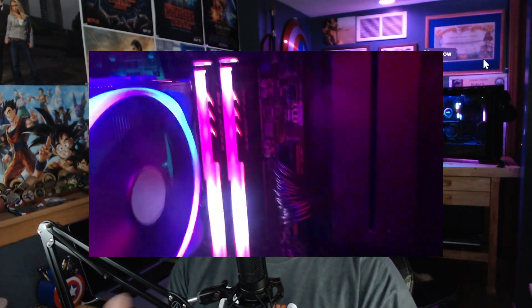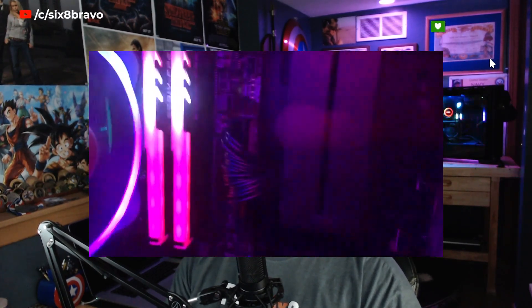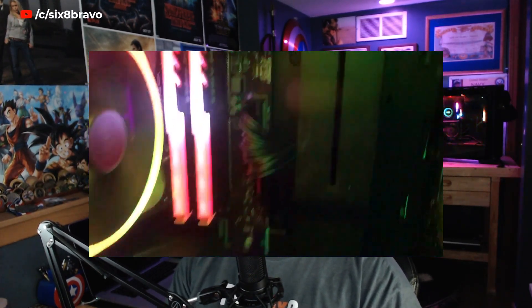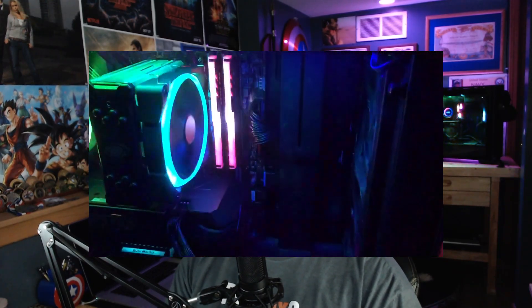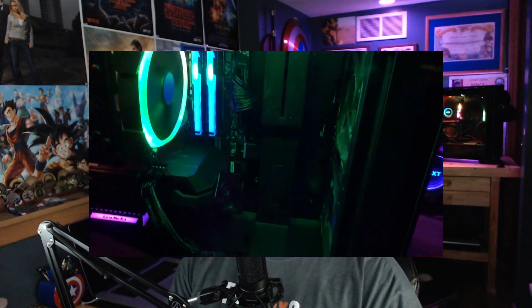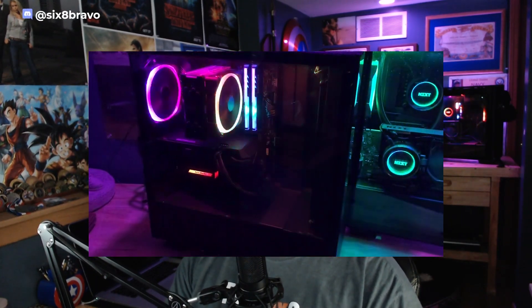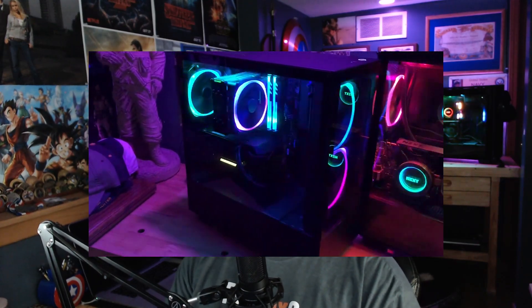If you have a Starter Plus and are thinking about upgrading the RAM — if you want RGB RAM or anything — please note that the RAM does stick out farther than the fan, so you can only put it in a couple of the slots. I had to move the T-Force RAM over to the slot right underneath the fan because the new RAM would not fit in there. It's too tall.